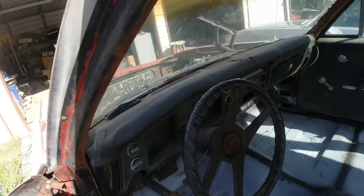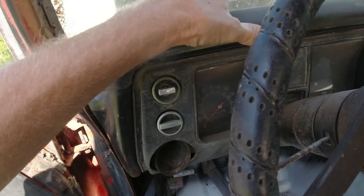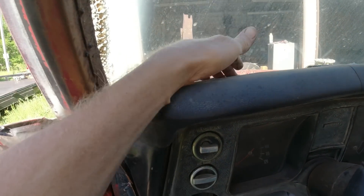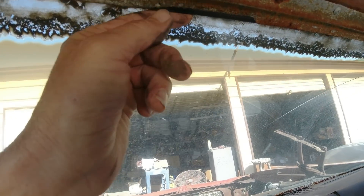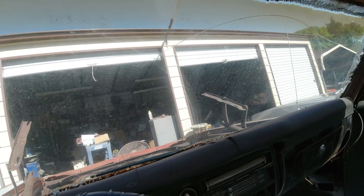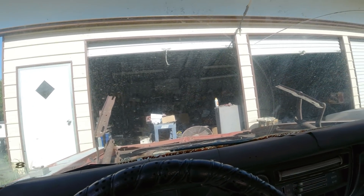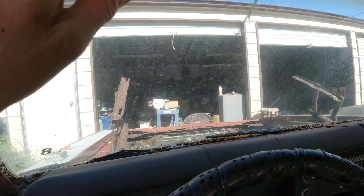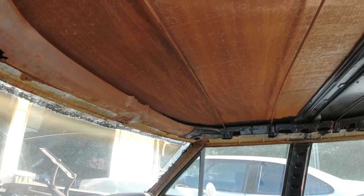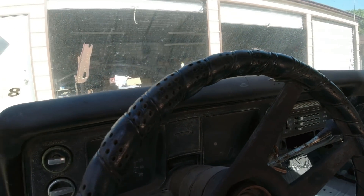The windshield frame and all that — I'm probably going to have to drop the column, take this dash thing out, the gauges out, the dash pad, just to get at this piece here to cut it out. I still don't know what's underneath here. It's got this little piece to mount the wind lace, so I don't know what's underneath. I'll wait until I pop the windshield out. I've gotta see if a two-door coupe is the same as this — I got one of them. If not, I'm going to see if I can get a new one. I could reuse this one but it's pretty nasty. The other job is to put a sunroof in — take one of them sunroofs out of the jeeps.